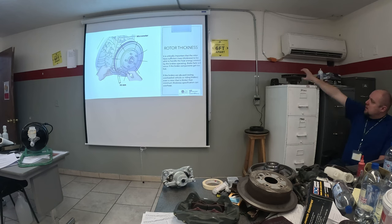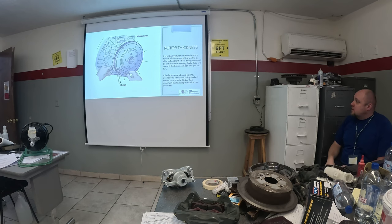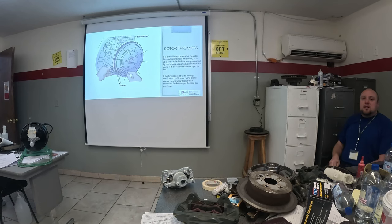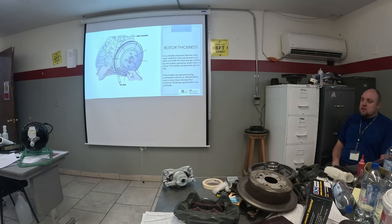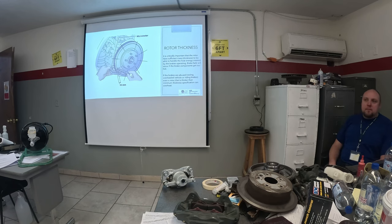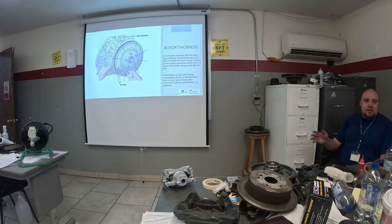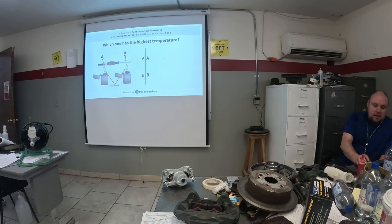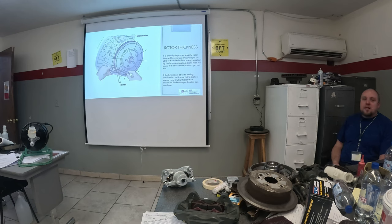As you can see, a car is going to have the same thermal heat energy demands on its brakes — because to slow a car down you're converting kinetic energy into heat energy. But if you have a rotor that's nice and thick versus one that's worn down and thin, they're not going to handle it the same. The thin one is going to overheat — it will have the highest temperature, because temperature is the concentration of heat energy. That's why rotor thickness is very important. There is a minimum thickness specification, and if the rotor is below that, it's not safe. When brakes overheat, you get brake fade — they stop working.